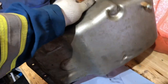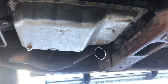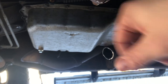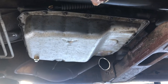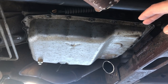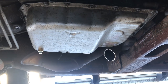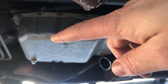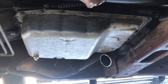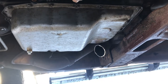The transmission pan is reinstalled. You can see we got the drain plug there. The book says to torque these bolts to about 12 foot-pounds — I went snug. Fingers crossed that drain plug doesn't leak, because if it does it'll be hooped and I'll be buying a new drain pan. This is all done down here.